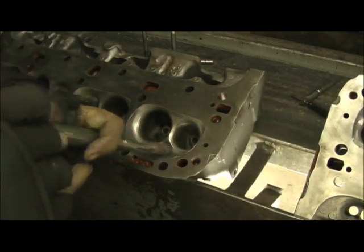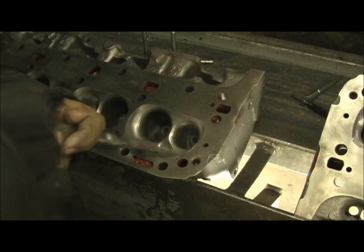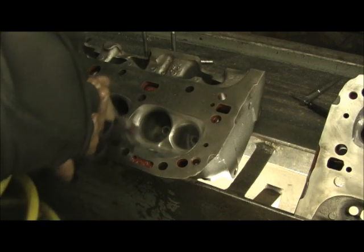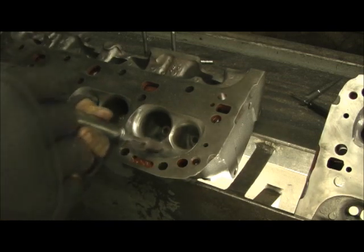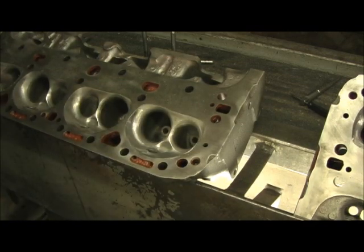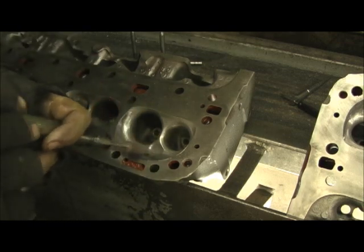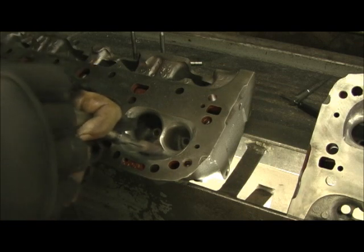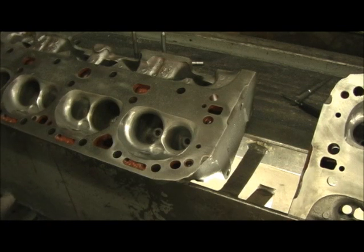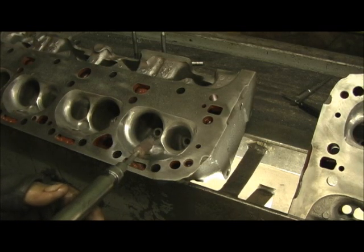What I'm going to do now is finish going back over them with 200 grit, because they were only taken to about a 50 grit polish. After going in there with the grinder and leveling them out, I could see there was a little room for improvement, so I want to go ahead and repolish them. This is 200 grit, then I'm going to go to 340 with the cross buffs to pull it in.